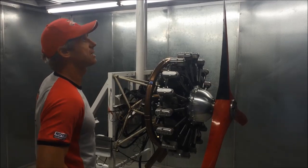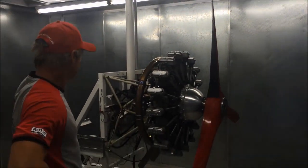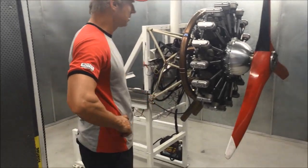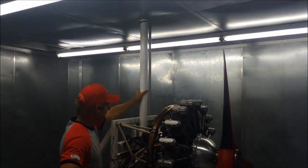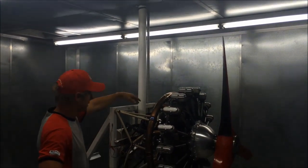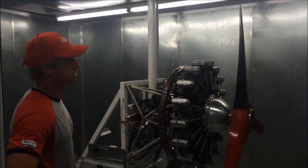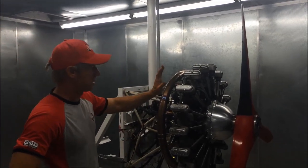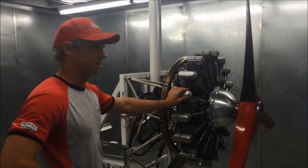There's a few little changes I need to make - probably add a fan to the front to keep air circulating after shutdown, because it gets pretty hot and gassy in here. Down the track we'll make an exhaust system that routes outside the booth. For the moment I've got fresh air feeding the throttle body from the outside, which keeps the TBI happy, otherwise it just starts sucking in its own exhaust gases. We can't run the engine at full power for all that long because it starts to get pretty hot, so we have to do it in spurts and cycles.